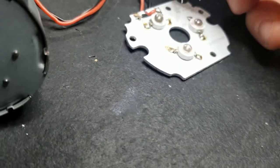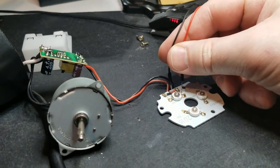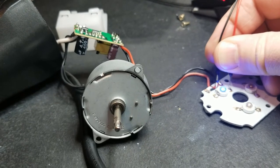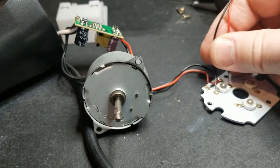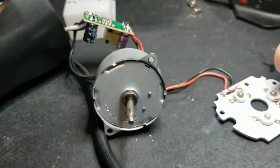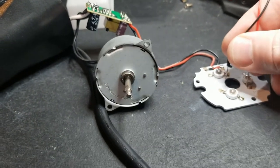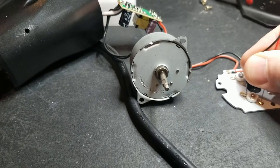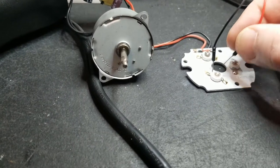This LED, which is blue — everything's unplugged right now, don't worry. That blue does come on. Blue takes quite a higher voltage, so even though it's a lot dimmer, that should be correct. And then this one — green. That should light almost as much as the red, and it doesn't at all. So that LED is right out.